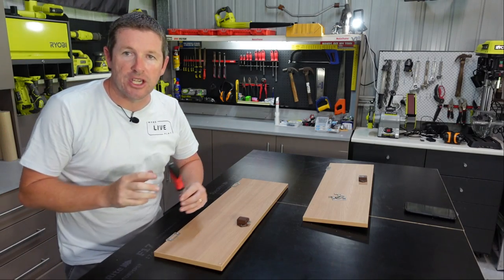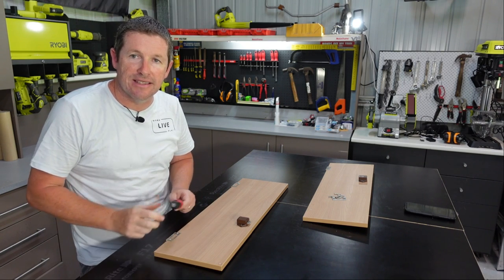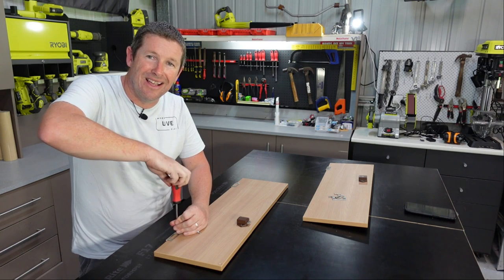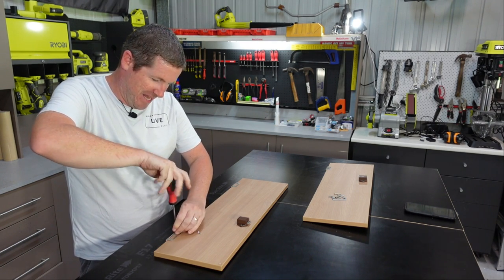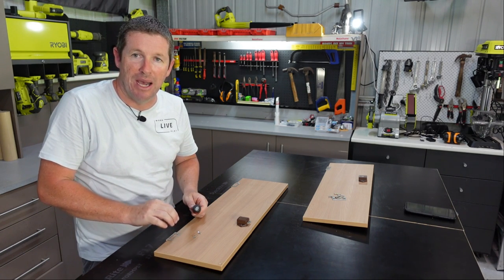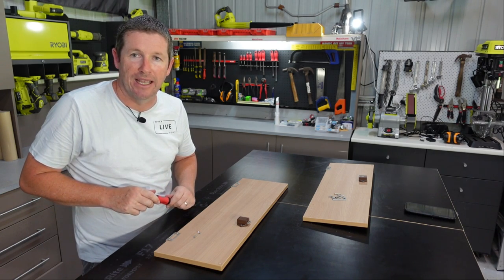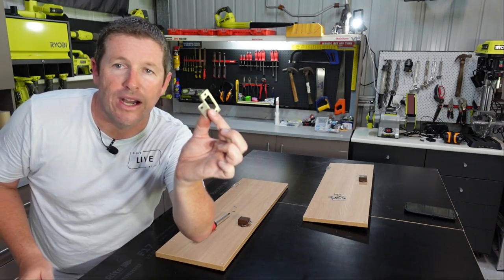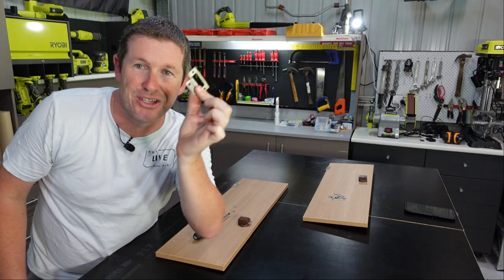Back in the shed, the first thing you want to do is remove these hinges so we can disassemble the pins and flip one of the pieces around. I use a screwdriver as it's really easy to do. And to be honest, you don't want to go pulling this really soft timber and having the screw thread through so you can't fix it all back in. Now I take the hinge and put it on the vise so I can pull these pins out. Show you that right now.